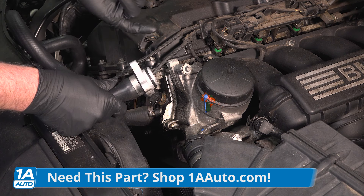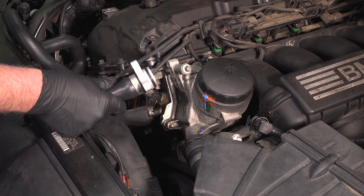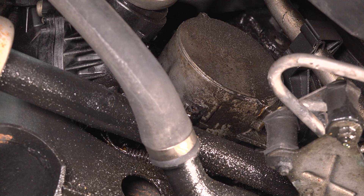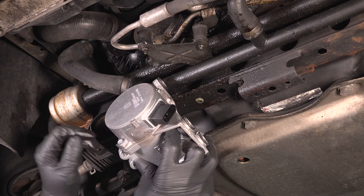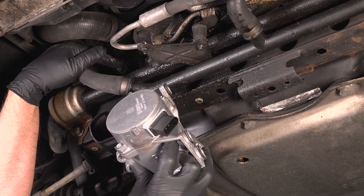This new style is aluminum, so that's going to prevent any headaches there. The water pump is best viewed from underneath the vehicle, and it is an electric water pump — you're going to have a power connector going to it. You don't have to deal with any belts or anything like that. It's a little bit tricky to get to, but not too bad, and you can see there's a thermostat housing right next to it.